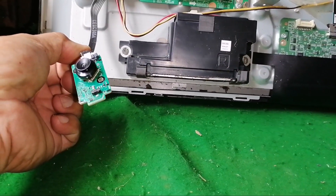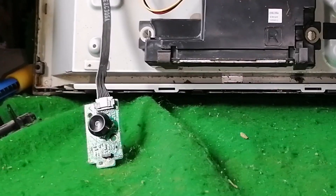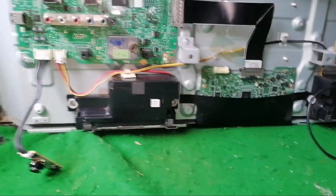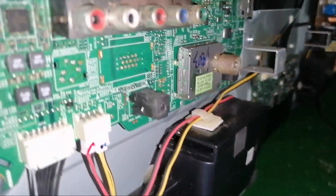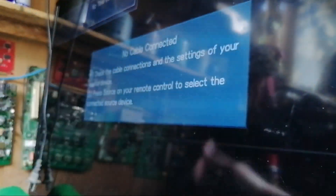As we can see and hear, there's a power-on sound, so maybe we are finished with our repair. We can hear the power sound when the TV turns on. We check the screen — we are successful with our repair on the Samsung 32-inch. By replacing the main board, our problem is solved. Thank you for watching everyone, and don't forget to subscribe to my channel and click the notification button for more updates.